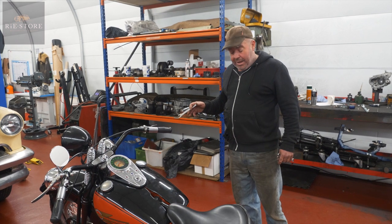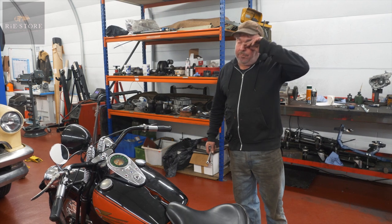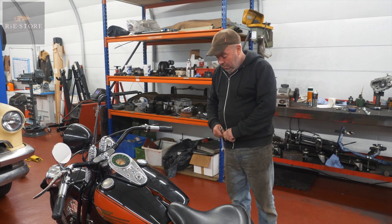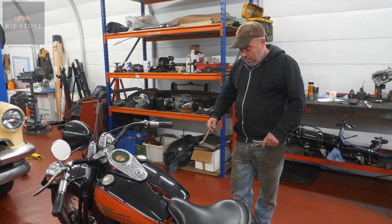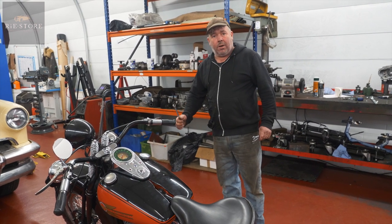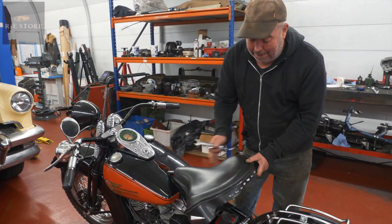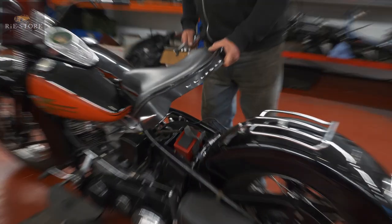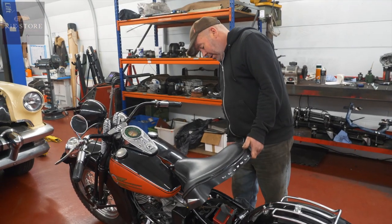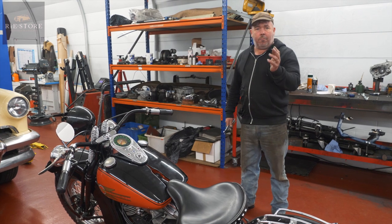The front wheel bearing was wobbling so I've sorted that. The owner is about six foot tall so he can't get his foot on the brake pedal properly. What I'm going to do today is take the brake pedal out and move the pin forward so he's got more length on it. The seat post is out too because he needs the seat to come back and have taller springs with heavier grade springs. We've ordered all that up.